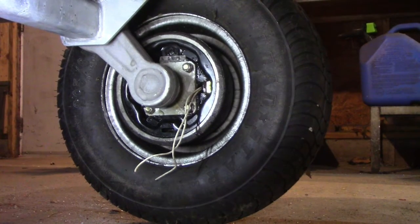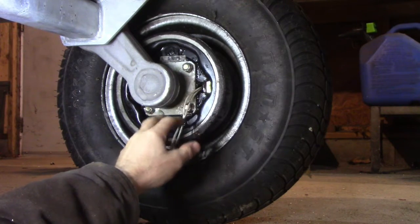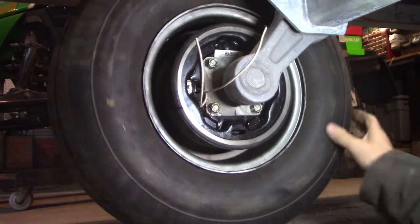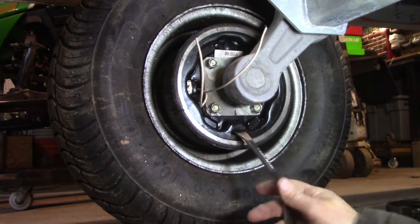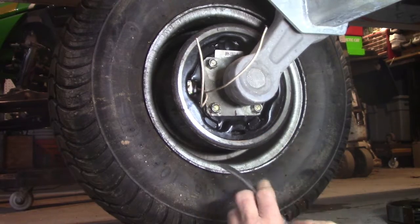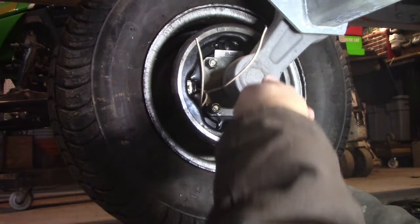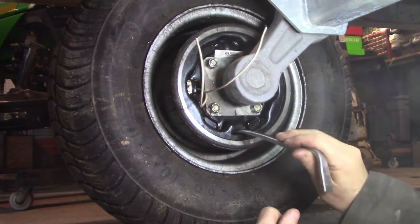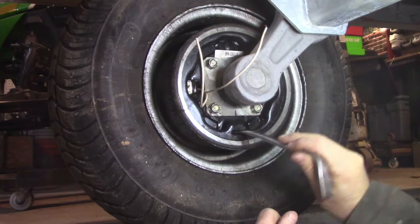Before we wire this up we need to adjust these brakes. We got the brake on the backing plate — four bolts — and then we put the drum on. Now it's time to adjust the brakes: the star wheel is all the way closed, and you use a brake tool going up or down. I can see in there the star gear is closed so we can only go one way. It doesn't want to move going up so let's go down — there, it looks like it's moving. The spring's on the other side so you get that clicking. So we're going down.